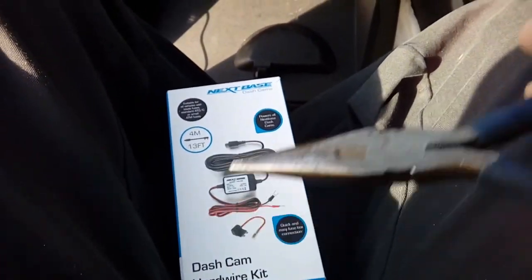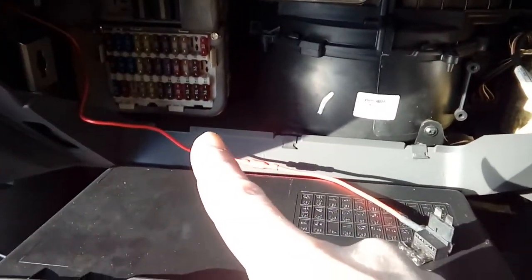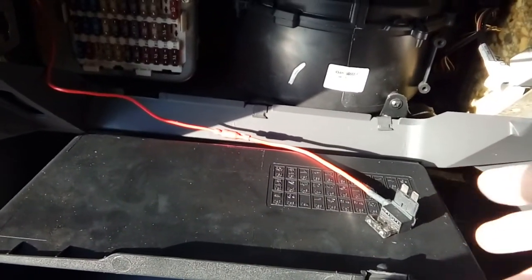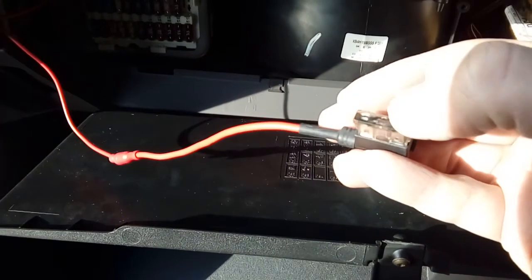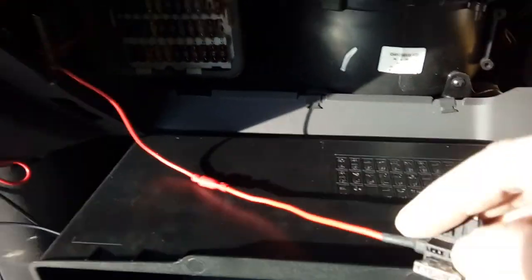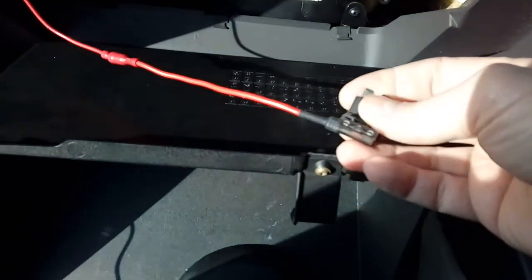Your fitting kit and fuse box is located behind the glove box on this vehicle. Here's the fuse spur — what you've got is one fuse to run the camera and a spare socket to hold the fuse you remove from the fuse box. So you plug your original fuse from the fuse box into here, and then plug this whole assembly into where that fuse came from.